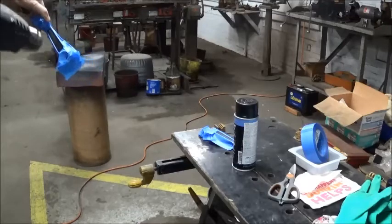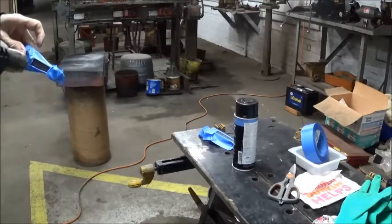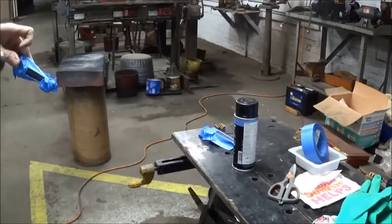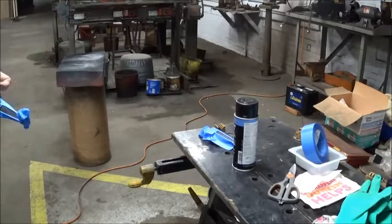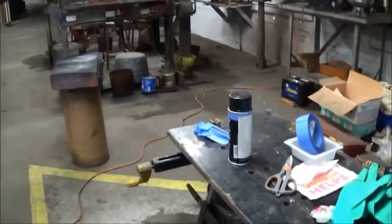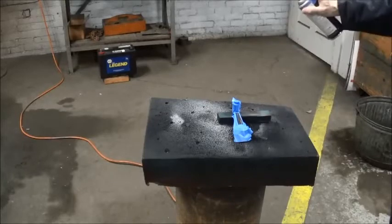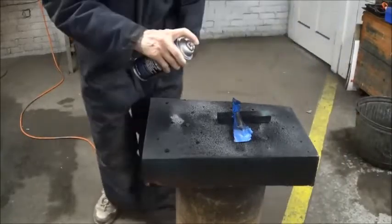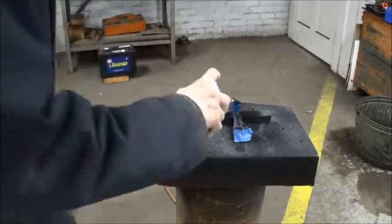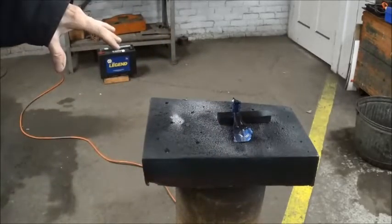I will also apply the heat on the handles. Paint sticks better to a warm surface than it does a cold. We're not talking hot, just warm. Now the trick will be light coats from different directions. Make sure you're working in good light. Then you can see that the paint is filling.